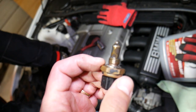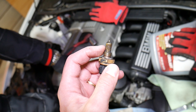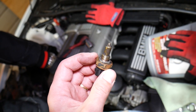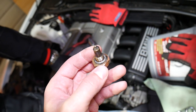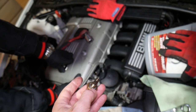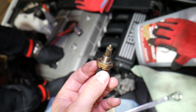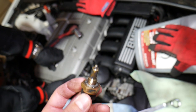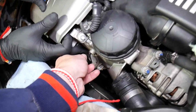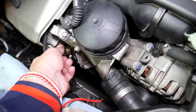When you get the new sensor tight, be extremely careful — this sensor is super easy to break because it's hollow on the inside. Don't over-tighten it; we'll put the torque specs in the description below. Also check that washer — make sure it came with the new sensor and isn't stuck on the cylinder. Grab the new sensor, pull your finger out of the hole, and install the sensor.